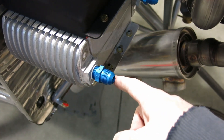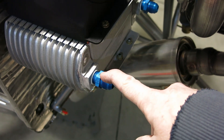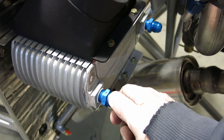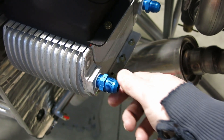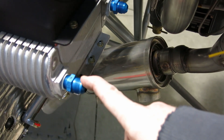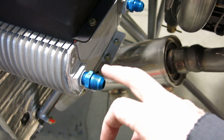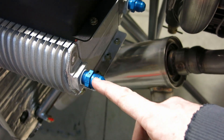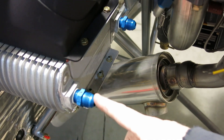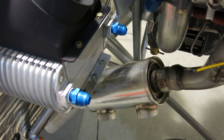Got the oil cooler fittings installed. Those are NPT fittings, so we did a thread sealant on there. They say one to two turns past finger tight — I got it finger tight, took it in two turns, and right when I was getting to two it got pretty tight, so we'll leave it at that. This is an AN fitting — I think an AN816; I don't have the parts list in front of me. On the newer kits they ship with a stainless steel fitting rather than the aluminum AN fitting. This was the different one that they had on the original kits.